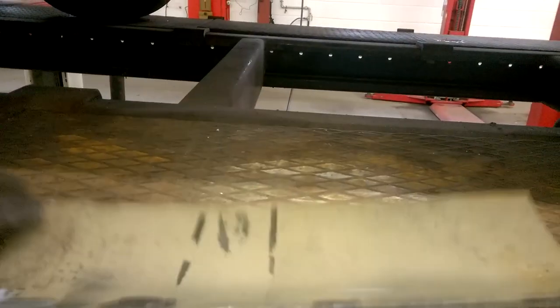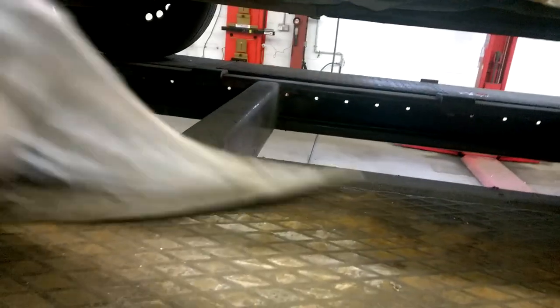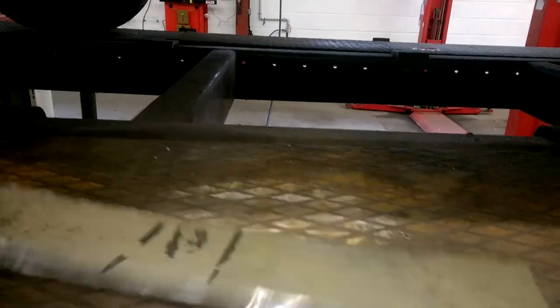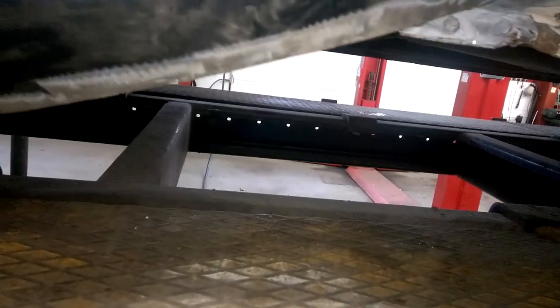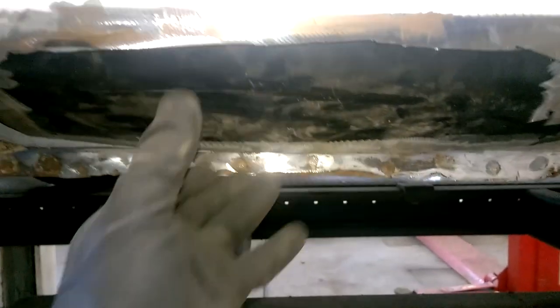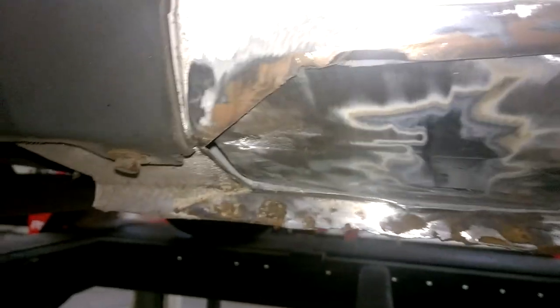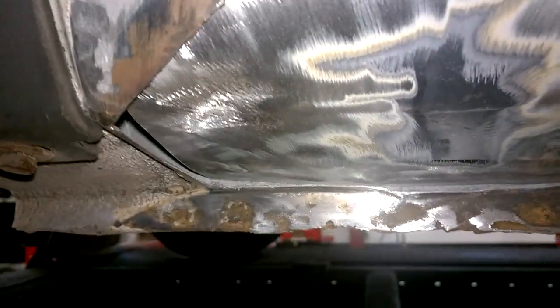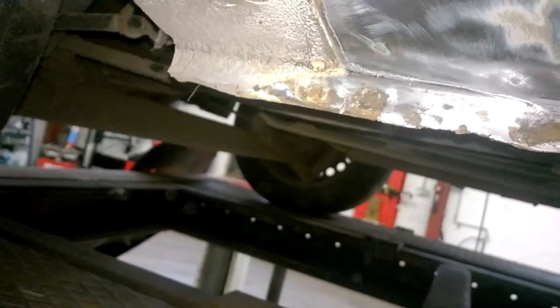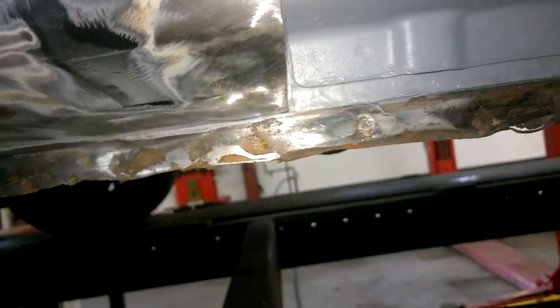This piece here is out of a wing — perfect for this, exact same thickness and all. I've started to shape it already. The idea is it'll sit up there like that and then be pulled down. I'll probably split this in two: do this section first and then press down on the other section and do that. So I've cut this piece in half — it'll be coming from inside out, pressed all the way to the edge, welded all the way along there, and then joined up to this side with a butt weld.